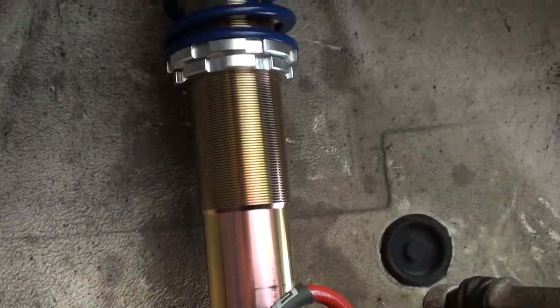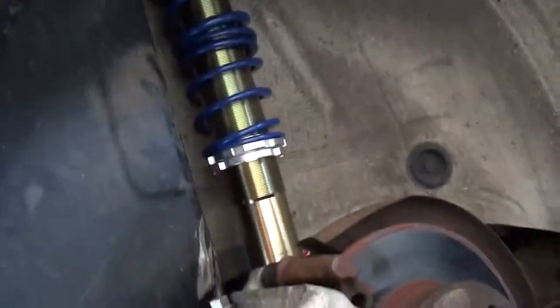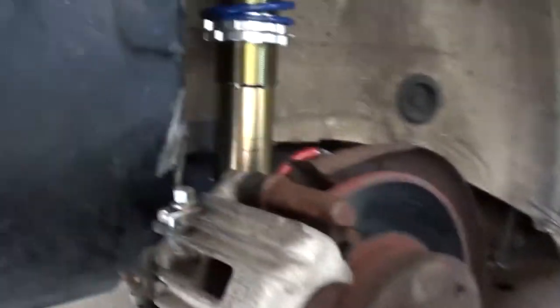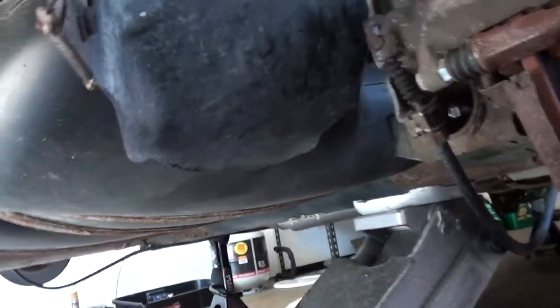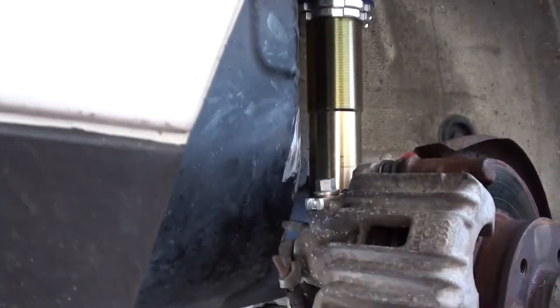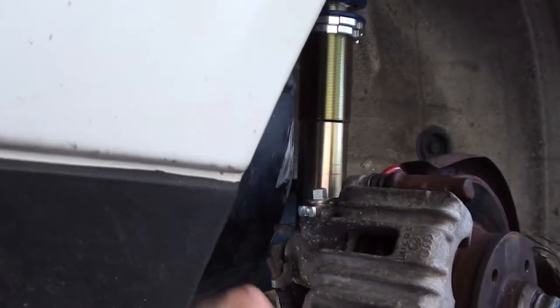So I guess we're gonna count threads now and kind of see what the ride height is gonna be like. Both coilovers are in, the mounts up top are tightened, and now we're just counting threads here to see where we want it to sit. Right now we're taking off the gas tank protector. I'm gonna angle grind that part off and then put it back on, because it rubbed stock, so I think it'll rub like this.